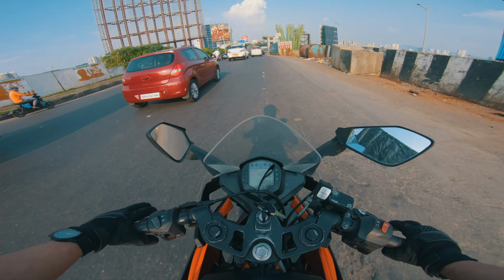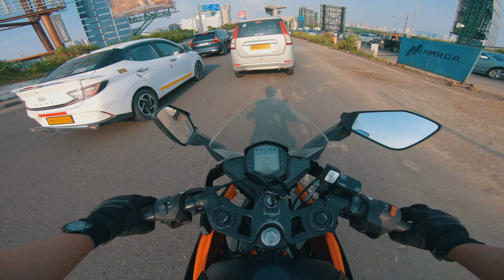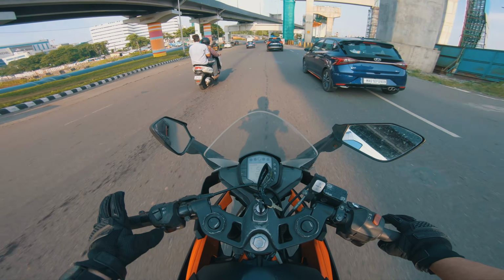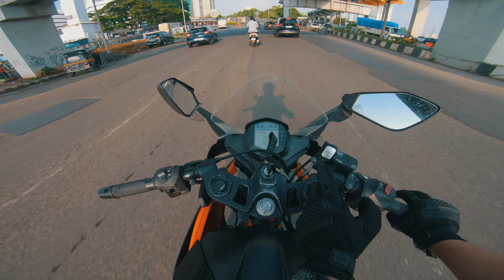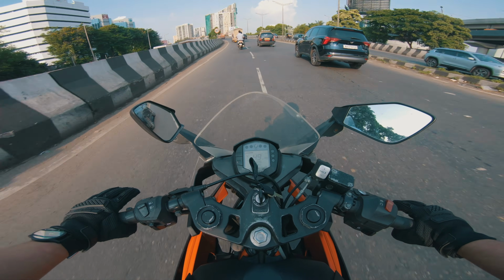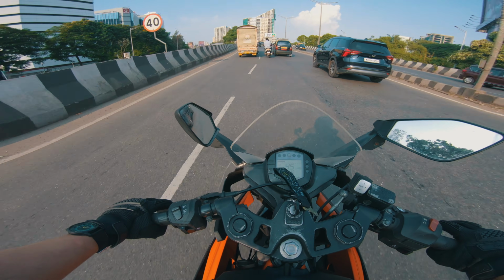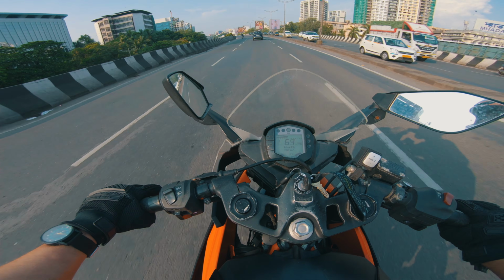So with the stock RC, what happens is that you have to wait till 7000 RPM for something to happen. Now fortunately it's a very quick revving engine, but on this it isn't the case that you have to wait till 7000 for something to happen. No, it's starting from like 4.5, 5 at partial throttle. So the dead spot is gone. So I think that's probably the biggest improvement that I can feel so far.